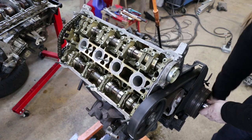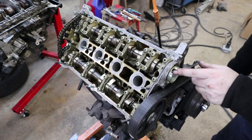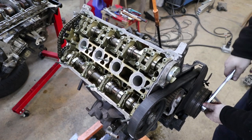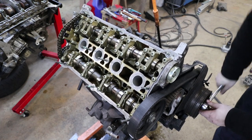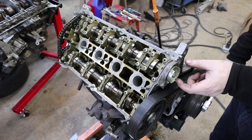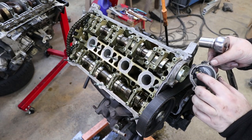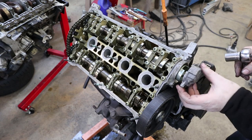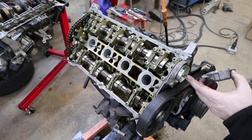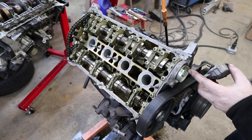When the engine's turning, you can see the cams and chains turn. There's a sheet metal wheel with a notch on the intake cam — that's where your cam position sensor goes. When it sees the break in the metal wall, it knows it's at a specific spot in the cycle. Right here is about where the engine's at TDC. That sensor has its sensing element right at the top, so when it's in place at TDC it sees the little window. Using the cam sensor along with the crankshaft sensor, the engine knows where TDC is and also knows the RPMs.